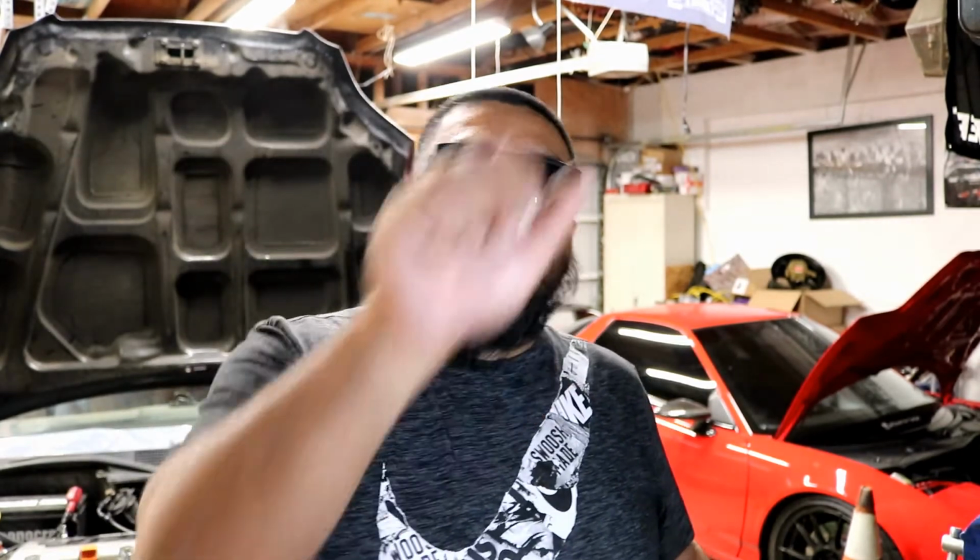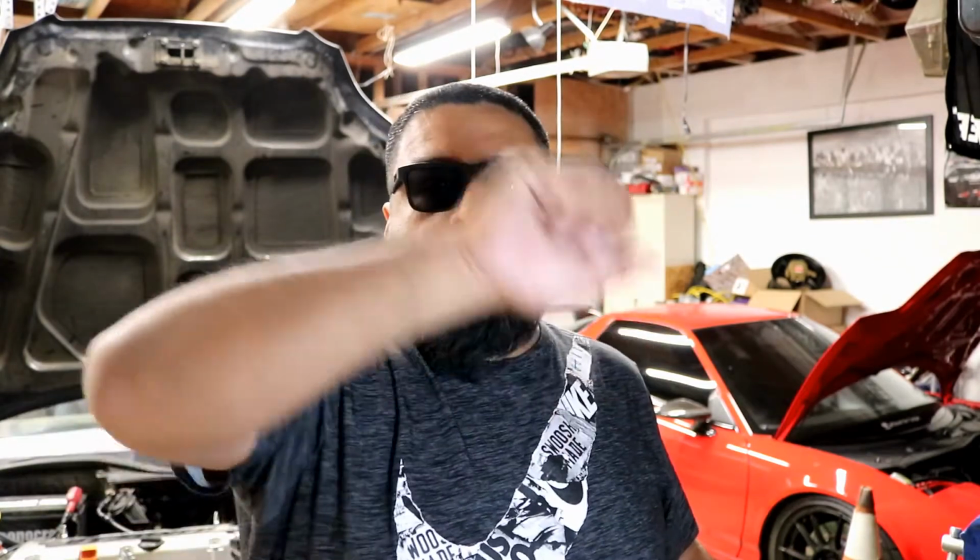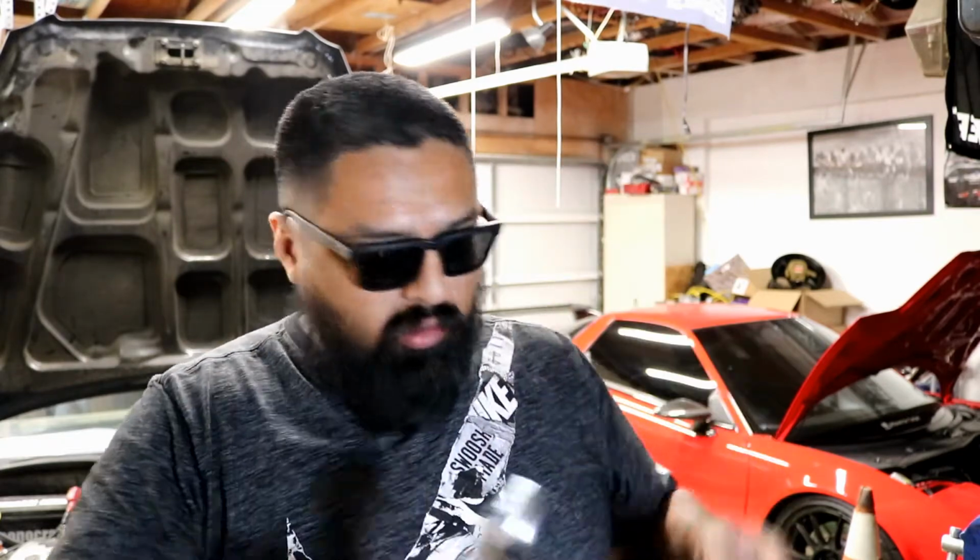Once you're ready to remove the right side, you do the same thing. Turn the steering wheel all the way left, and then the right side is going to pop out and give you access from the wheel well. And you just remove it, take it out, and that's all it is. Very simple. You don't need special tools. Just don't be afraid to get your hands dirty. So now we're going to throw this new stuff in and get ready for alignments.